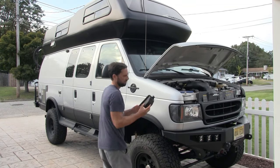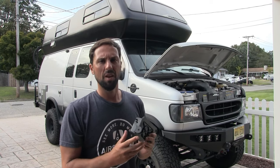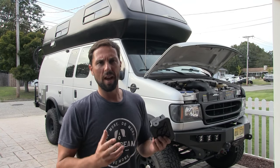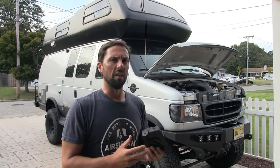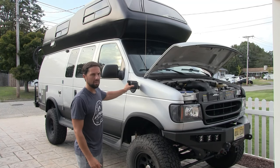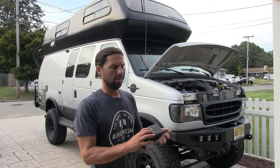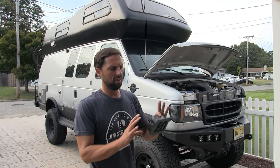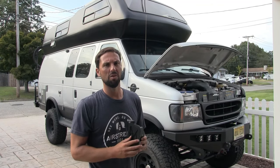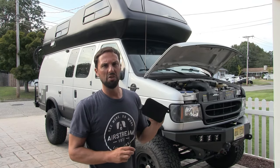This accumulator and a little check valve wind up going bad, and you lose vacuum temporarily. The engine starves the system of vacuum, and once you restore vacuum by letting go of the gas or getting up that hill, you get the air conditioning back. But this is buried underneath the dashboard — the whole dashboard has to come out, the whole heater box has to come out. It's all labor-intensive. I'm going to show you how to bypass the one underneath the dash and install it elsewhere.